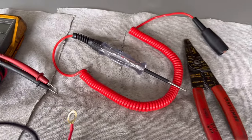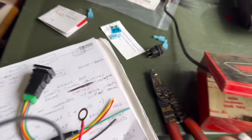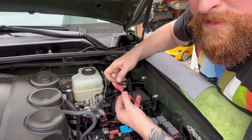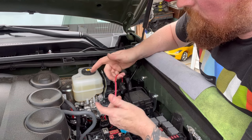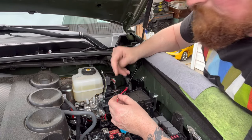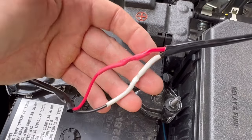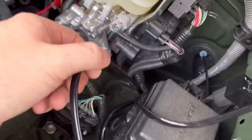To play it safe I have my multimeter to check voltages, a test light, and this tool makes working with wires a lot easier. Always use shrink wrap tubing — especially in the engine bay — to protect your work and keep corrosion away from these components. Quick recap: this is the wire that comes from your Raptor lights; I soldered it with the shrink wrap — not the cleanest job, but I'll do another layer and wrap it up cleanly. That's one bundle, then you've got the other two.